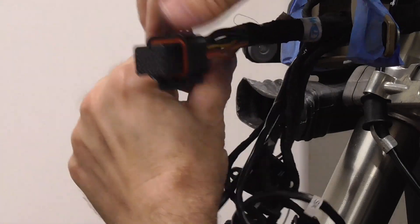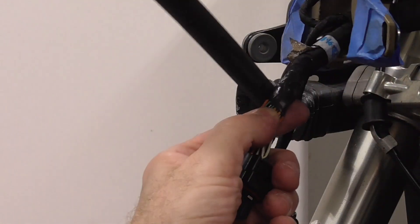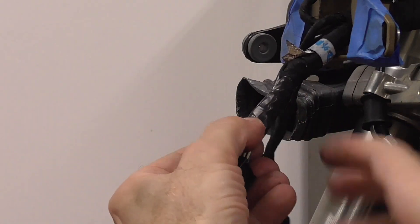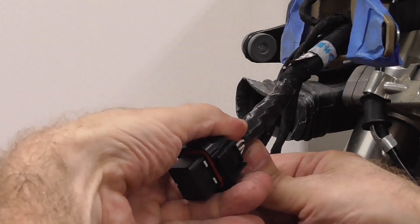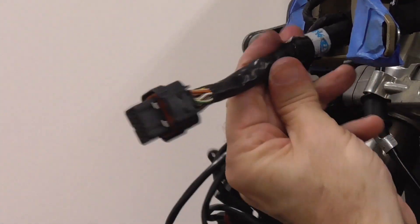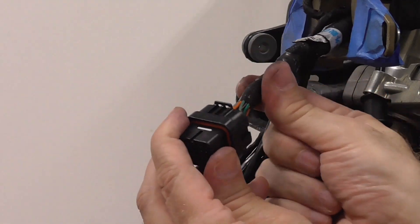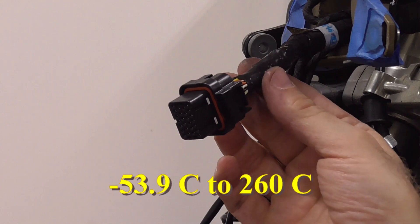Okay, let's go back over to the bike. I'm going to use this first little piece to secure all of that — pull it as tight as you can. Use the fingers of your other hand to keep it in place while you're pulling. I'm going to leave about an inch on the end, just like they did in the factory. That's our new wrap. I like this silicone tape a lot better — if we ever have to remove this again we're not going to get all that sticky grimy stuff on our hands. It has real high temperature resistance — minus 65 degrees Fahrenheit all the way up to 500 degrees Fahrenheit.